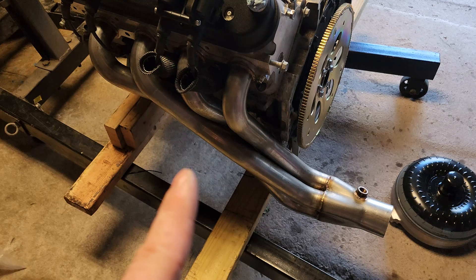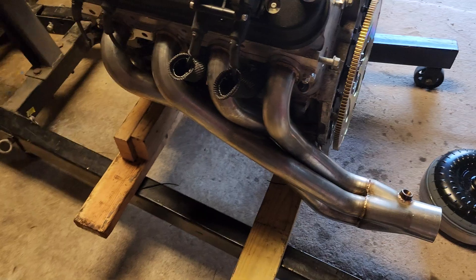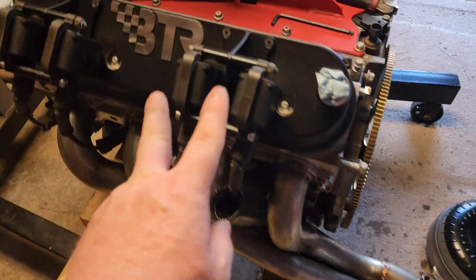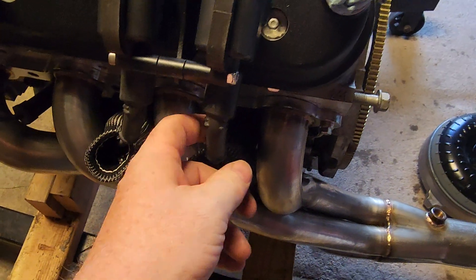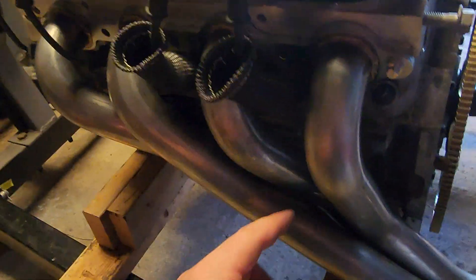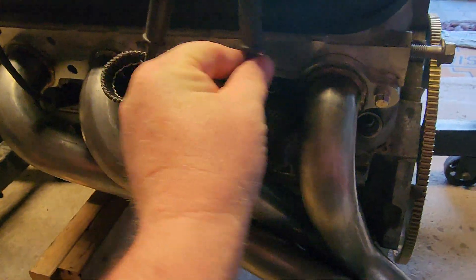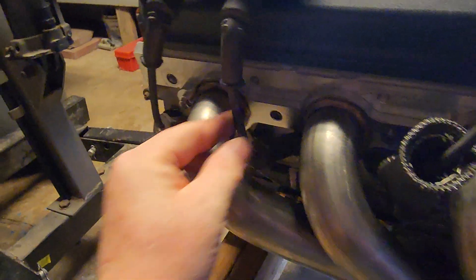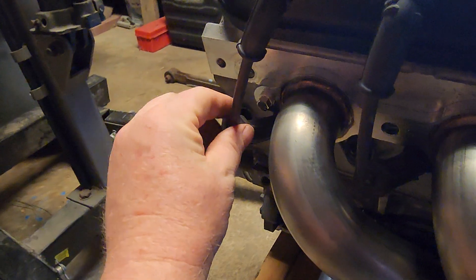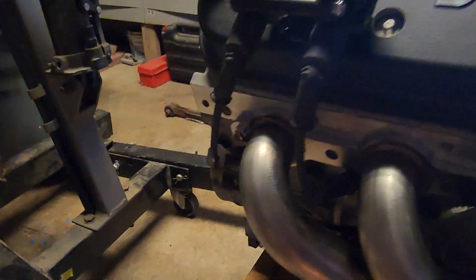I have Speed Engineering 1-7/8 inch long tube headers for a third gen LS swap for a third gen Camaro. I went ahead and put them on here. I got the coil packs all bolted up and tied up. I went ahead and put spark plugs in just to see how it would look and if they would fit — and they do. You got a little bit of room on that one. That one's not bad wire-wise. This one's a little more snug and this one here is pretty snug, but I do have it snapped in there and I think it'll be all right.